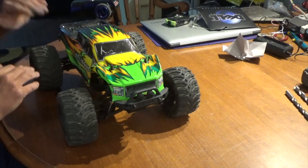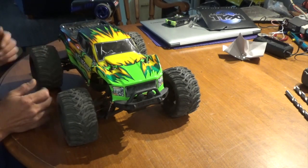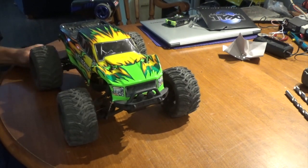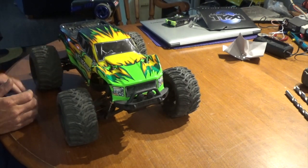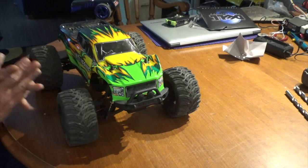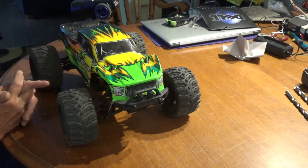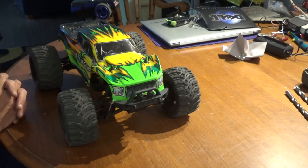It's got all steel gears and a brushless system. I definitely recommend lowering the pinion to a 17 and ditching the servo for something stronger — even a 15kg servo would be a massive upgrade. I'll probably go 15kg; I've got a few kicking around. The stock servo does work, but it's weak, especially on recovery time — a little sluggish.